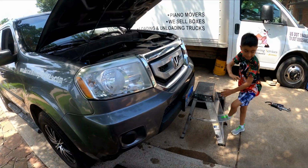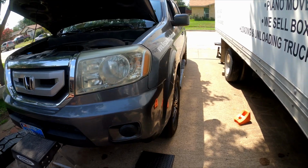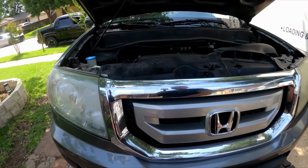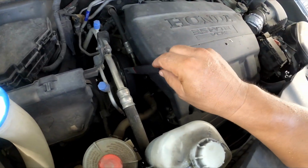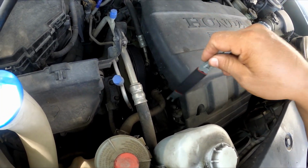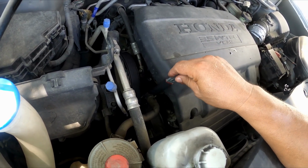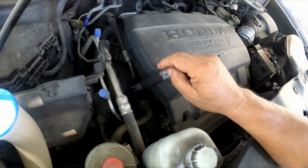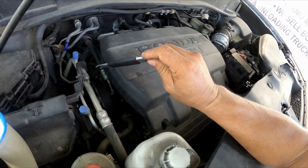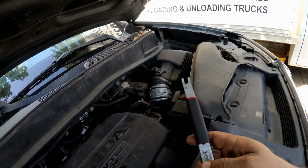Okay, here's my little helper right here, super little junior. What I'm gonna do first, make sure the engine is cool. I'm gonna take off the air filter box and the air filter hose, and one more thing. In this part right here, what I'm pointing at right now, behind this is the timing belt and tensioner. I'm gonna show you in the next video how to replace those parts. Okay, also I'm gonna replace the water pump as well.